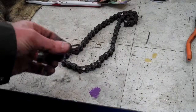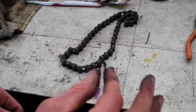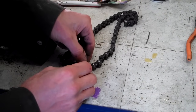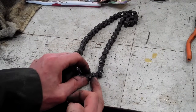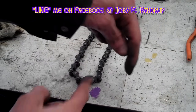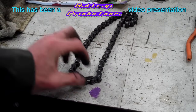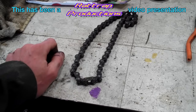We're going to put the open side on — there's an open side and a closed side. You've got to make sure it goes on just like that. You've got to make sure that the open side trails. So if the chain goes this way, the open side is this way and the closed side is this way. When the chain pulls through, it doesn't put any stress on the open side — it's all taken on the closed side. That's Joby Randolph with Rat Trap Productions showing you how to shorten the chain.